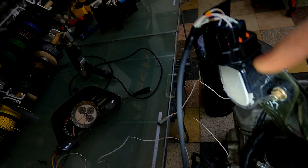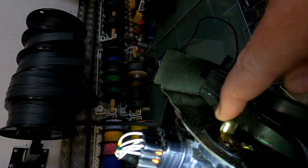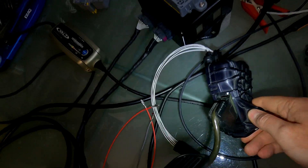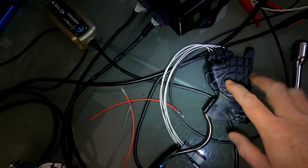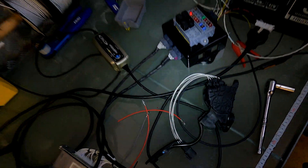Same principle — you've got a potentiometer right here which is actuated by an arm. These are completely enclosed. Then I've got one here — this is actually from a Hilux, but I think you get them in a Land Cruiser, Yarises, Priuses, etc. They all just have sort of different pedal positions on these ones.